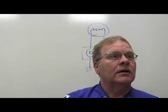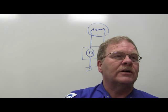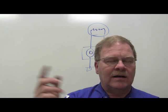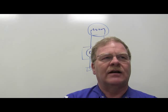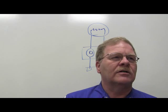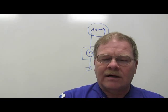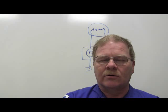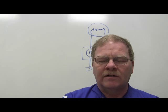And that 6 liter can doggone sure... Actually, if your fuel pressure gets really low, those injectors can actually suck fuel up in there, but it beats them up and it ruins the injectors if they've got really low fuel pressure and all that. I could talk for 3 hours about a 6 liter. But anyway, there's a sensor in that little horizontal fuel conditioning module on that 6 liter. What year is yours? 05.